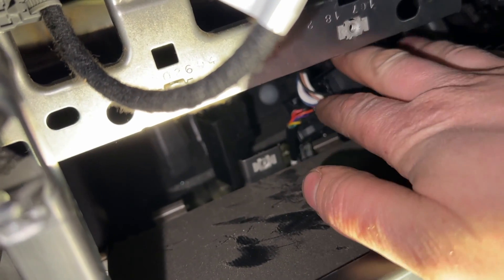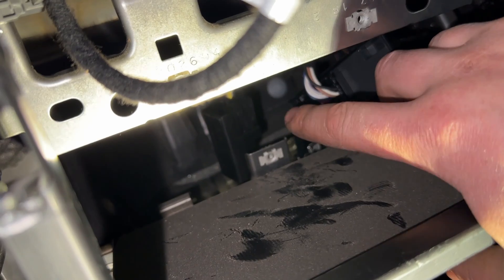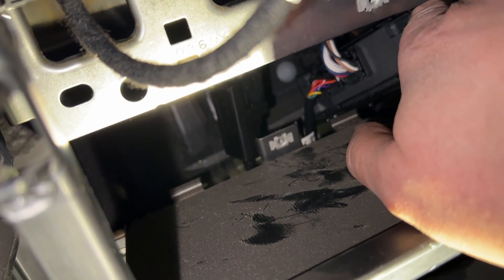The plug-in for the HP tuners bypass cable is the bigger plug of the two — it's the further down one. Unplug that, plug it into the bypass cable, and then plug the bypass cable back in.